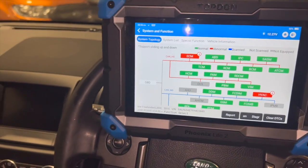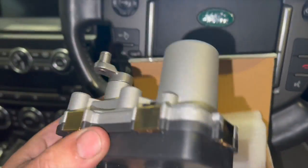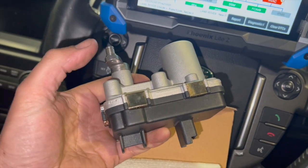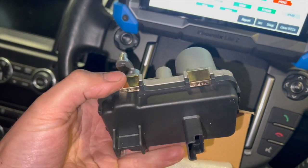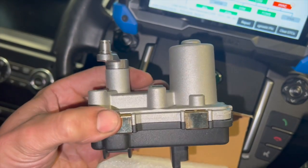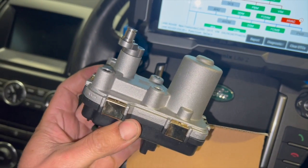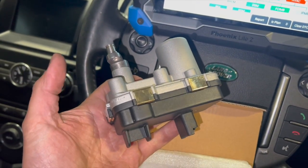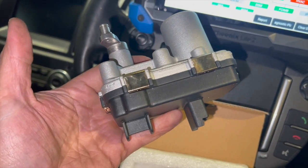The main issue is this — the actuator for the turbo itself. Some people will want to fit a full turbocharger, which strictly is the better way to do it since these come configured to the turbocharger. However, it's a lot cheaper to just replace the actuator unit itself. I've done quite a few of these on Transits and they seem to be a common issue. I'll put a link in the description to where you can get one.